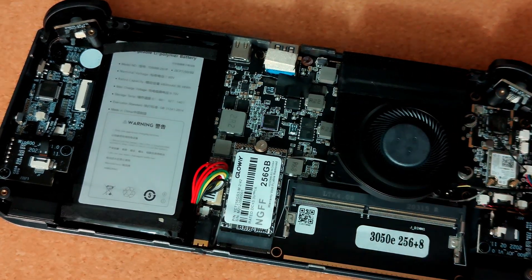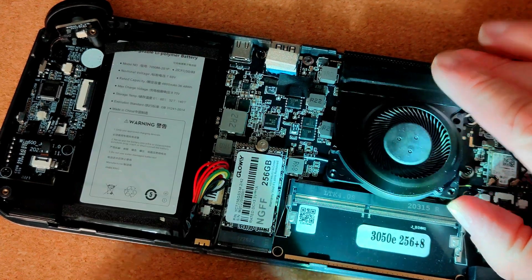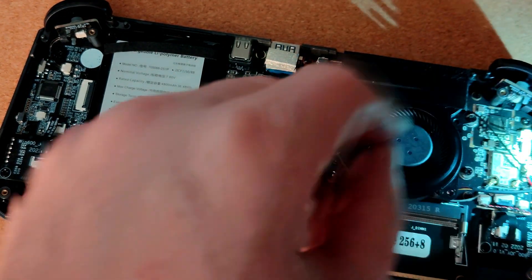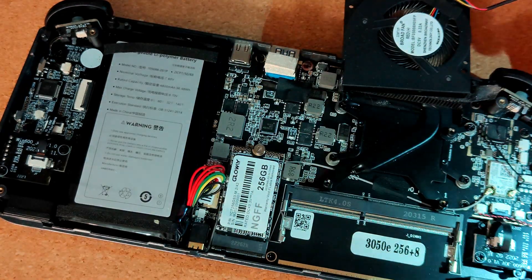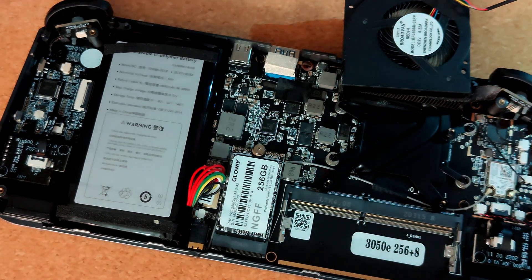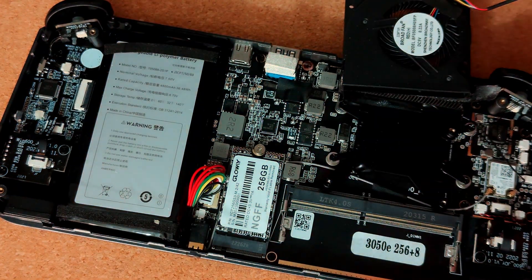It feels a bit tight. There's a little cable visible in the bottom right. Lifting up the fan to make sure I've not missed anything, I can see it's the tape at the top that's holding it tight on the right side - it's been fitted really well. I'll give it a little stretch to loosen it off, then release and pop out the power cable. You can see a flap of tape sitting at the side. There are four screws holding down the heat sink onto the APU.